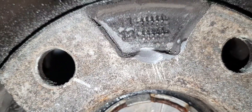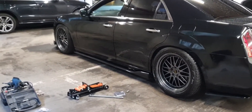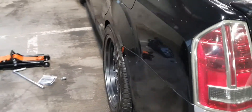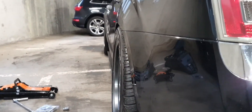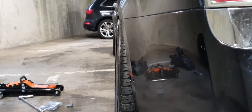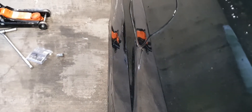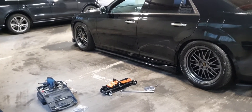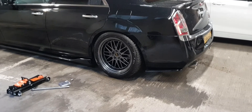Cut done for the stud - 22s off, sweet-looking 20s on. I personally think it looks freaking fantastic. The 295s just the tread is in, so it's legal, but I think I'm going to roll the arches slightly more and pull them just to cover the tyre a little bit - basically to keep the police happy. Eight and a half J with 255/45/20 on the front, 10J with 295/40/20 on the rear.